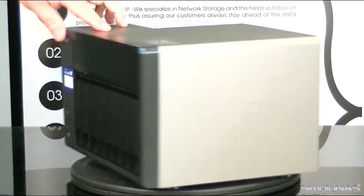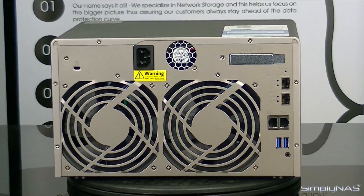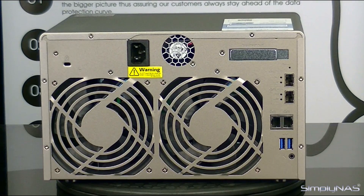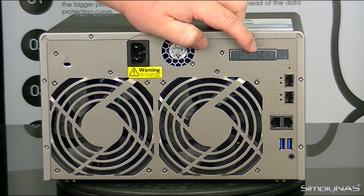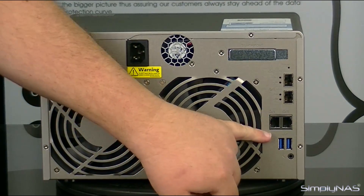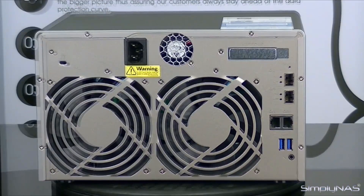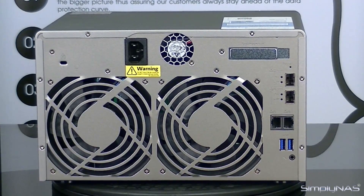On the back of the unit it is a little bit different. You'll notice that this one is much more enterprise-based or business-based. It doesn't have the HDMI ports like some of the other units have, but this is mostly because it's meant for functionality. You'll notice that over here you have the two SFP Plus ports — this card will actually allow you to add 10-gig ethernet ports as well. Then you'll have your standard twin 1-gig ethernet ports, your two USBs, your power port, plus your two cooling fans and an extra fan as well.